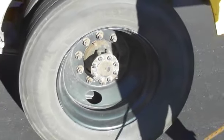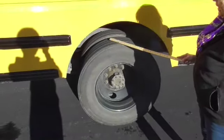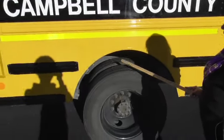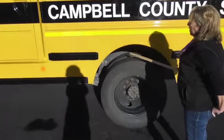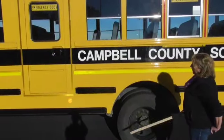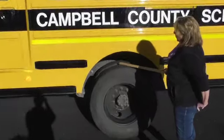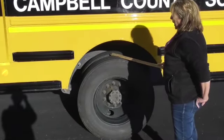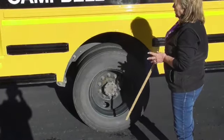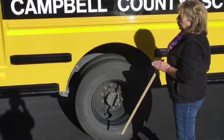As for the other items we would need to check at this back axle, there are four suspension items to check the same as I would on that front right corner — and you're allowed to refer to it back here during your test. Those four items are my shackles, my springs, my U-bolts, and my shocks.